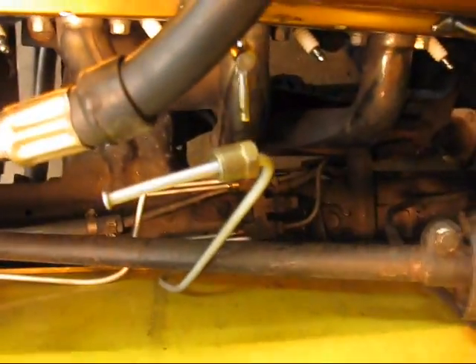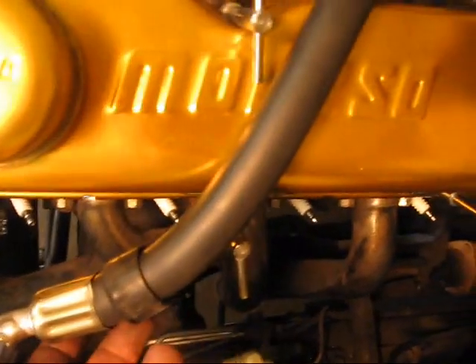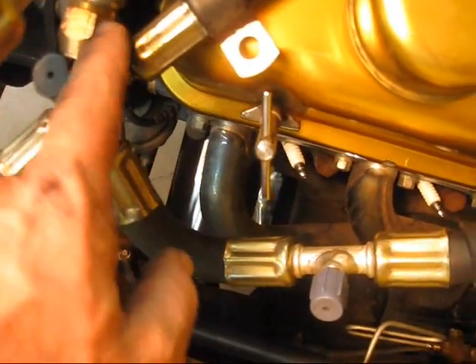Following the instructions right now — it's telling me to mount the booster and bracket to the firewall. If I do that it's going to be hard pressed to get these brake lines down to the little block. So I think what I'm going to do is mock the whole thing up real quick with a couple of bolts, put the proportioning valve on, get it all mocked up. Because these air conditioner lines are in the way and I don't know what I'm going to do about that — got to have air conditioning here in Texas. I may have to change this fitting and get it to come out at a 90 instead of the way it is and just run along the valve cover.